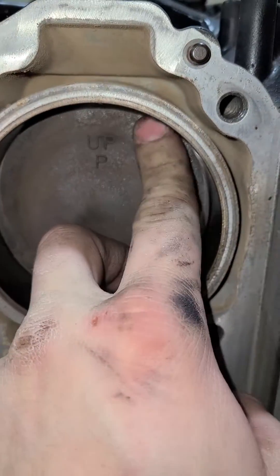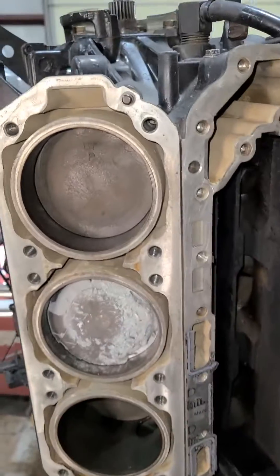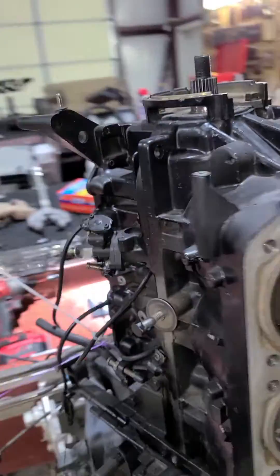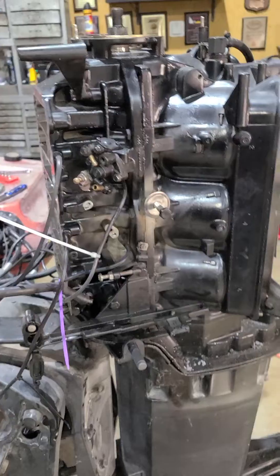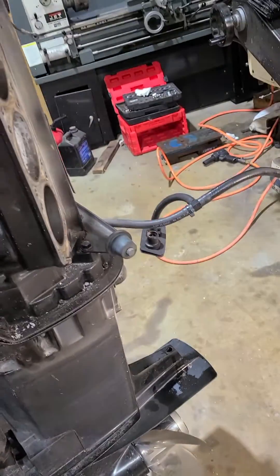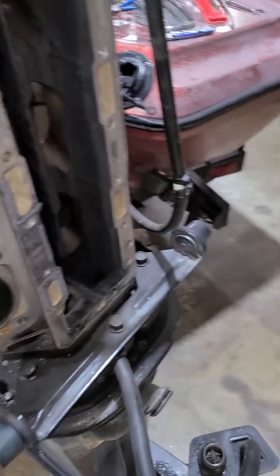The cracked reeds didn't help, but this piston here is also being damaged a little bit. So between the reeds, the oil delete, and the fuel not being great either - there was water in the gas - a couple of those things contributed. Also, the ring broke - came out of there - so not too good.